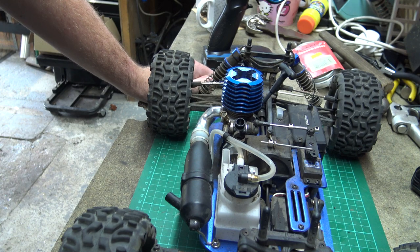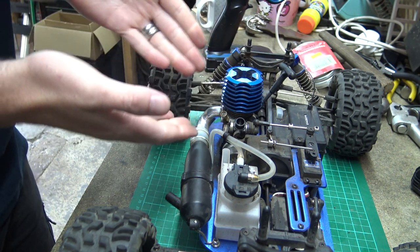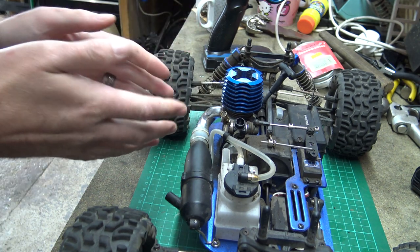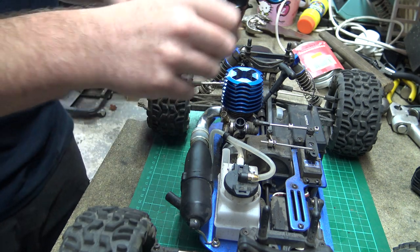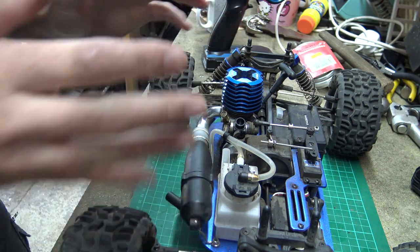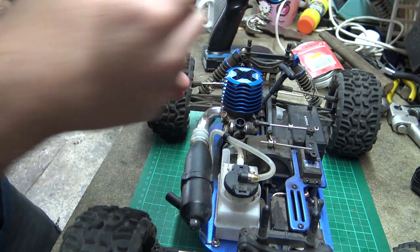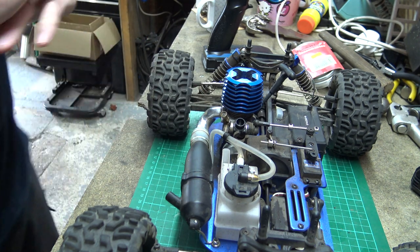It's just going to be different for every car — altitude, fuel types, tune-in, glow plug type, the condition of the engine and carburetor. There are so many factors that will change tick over speed, so you can't just measure it; you've got to experiment. And it's not a case of spending half an hour at it — without filming it takes literally about a minute. You don't even need to take the air filter off. Turn it so you can see the throttle is no longer being moved by the servo, it's at the end of its stop but not fighting, then start it up and adjust the screw until you've got a good tick over. It's as simple as that.